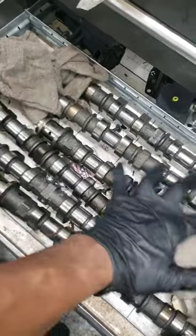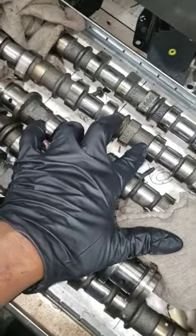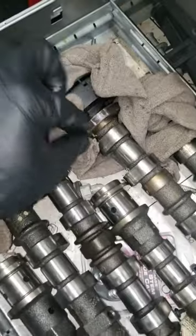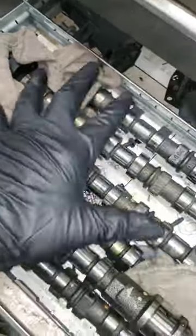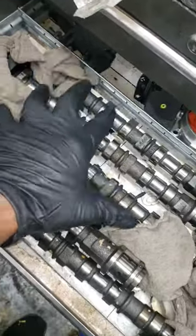You can have four brand new shiny silver camshafts in your car — it's not going to make it run better. You likely just wasted money. Inspect these lobes. If they're not damaged from worn-out valve train parts, they're okay. If the tone wheel is not loose — it's press-fitted — this camshaft is okay. Stop wasting money replacing camshafts; it's not going to make your car run any better.